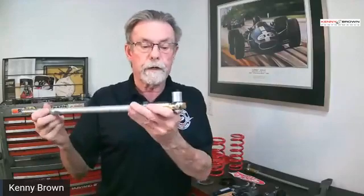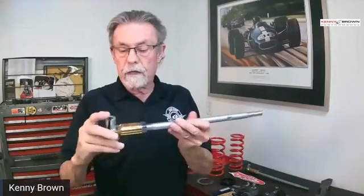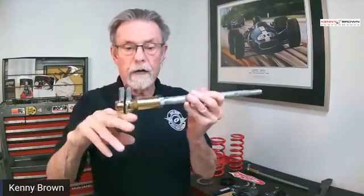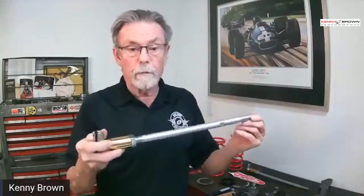So that's part 2 of the 3-part starting solution. We call this like step 1 for IRS. And the next one is the rear steer kit. Now, when we talked before, in an IRS car, when you go around a corner and get to a certain point of lean, both rear wheels turn the wrong direction. That's why it makes the back of the car so loose. With the rear steer kit, we actually move the inner pickup point all the way down to the bottom, which helps reduce the roll steer. It doesn't take all of it out, but it helps reduce it.